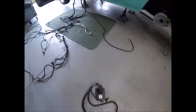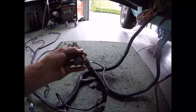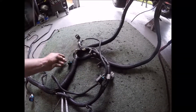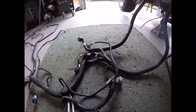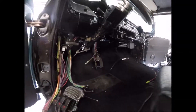It's fairly simple because you just have to feed this through the firewall depending on where you mount your computers. It tells you map sensor - this is in order right here, so this is the even side of the motor, you can't really mess that up. You plug them up - electronic throttle control is right here, it's basically plug-and-play. The only dilemma I have is I've got to figure out where to put the actual fuse block and the main computer for the LS motor.